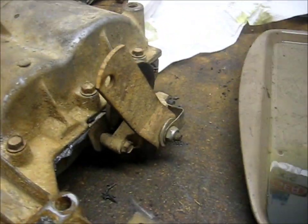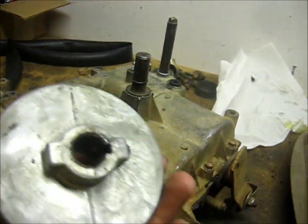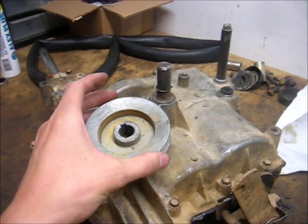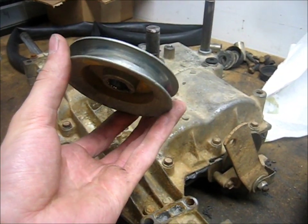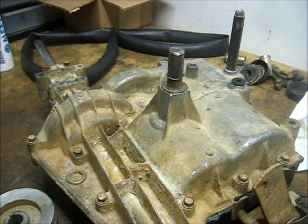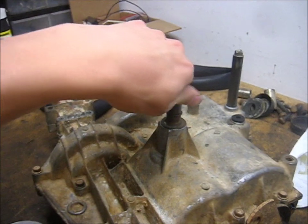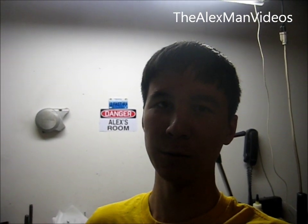Once you have the brakes all on and assembled you're ready to put your pulley on. I had a three-and-a-half inch pulley on here and that made the mower go 25 miles an hour with the six-and-a-half up front, but I'm going to be downgrading to a pulley that gives me a speed of about 15, because 25 is fun for the road but I use this more for off-road. With the small pulley the belt slipped a little bit when it got hot or wet, and 25 miles an hour is kind of useless off-road. So I'm putting on a 15 mile an hour pulley - that'll make it a better mower for off-roading. Once you have your new pulley on you can put it back in your mower and you'll have a locked transaxle. Stay tuned - I'll have a video of my 15 mile an hour pulley lock differential, and I'm going to redesign the clutch system because my current one doesn't work very well. You'll be able to see how it works off-road, so stay tuned. Thanks for watching.